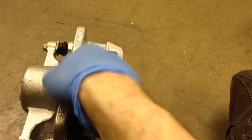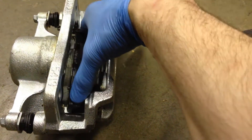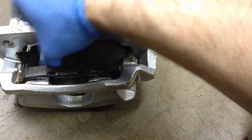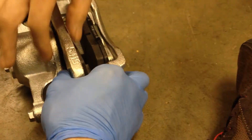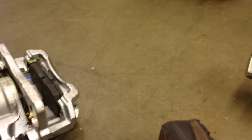It's not required. These pads will float and provide a very minor amount of parasitic drag, which, while lame, is difficult to avoid and might require a different caliper design, because even that glue-ish stuff isn't going to necessarily prevent the brake pad float. What it's going to do is dampen the vibration so the pads make less noise and don't squeak. So now we know that those are not required on the front or the rear caliper, unless we have a reason to reduce the noise and vibration.